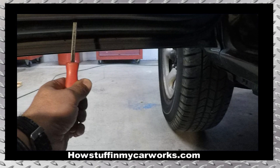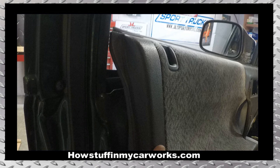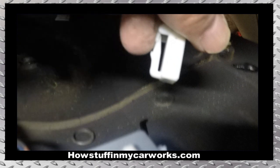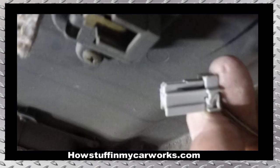Use either a pry bar or a plastic trim tool to release the door panel fasteners that hold the door panel to the door, starting at the bottom and working your way around it on both sides. Use care when you do this so you don't scratch the paint. Once the retaining clips have been detached, pull on the door panel upwards to clear the door lock mechanism. Disconnect the tweeter speaker electrical connector shown in the image. Detach the speaker wiring retaining tab from the door panel — it's easier to do it from the outer side by pressing on the plastic tabs with needle nose pliers and pushing the retainer out at the same time. Disconnect the dome light electrical connector and remove the door panel all the way.